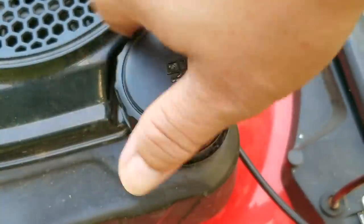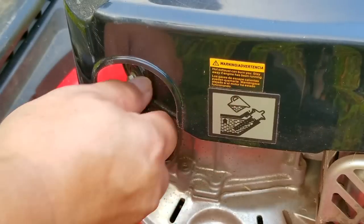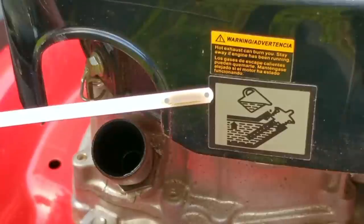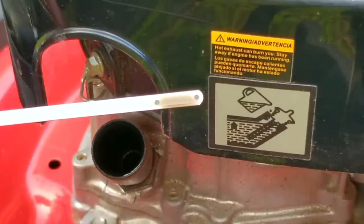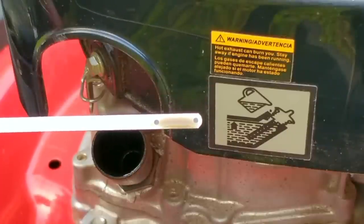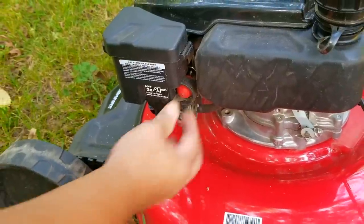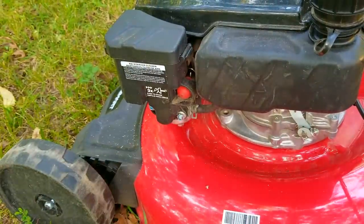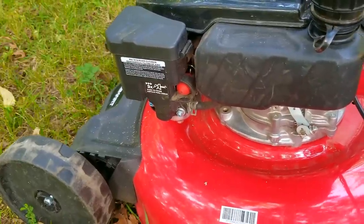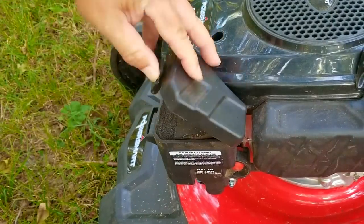The first thing to do would be to see what I'm working with. It looks like we have plenty of gasoline in the tank, although who knows what kind of condition it's in — so we'll need to drain it to examine it. The oil seems a bit dark for only having a couple of hours on the engine, so I'm beginning to question the information I've been given. Let's see what happens when we try to start it — of course it's not going to start, and the best part is it didn't even try.